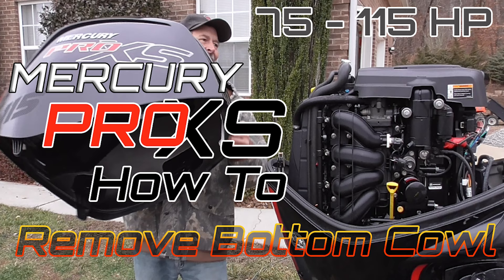At this point, you're probably thinking we'll just take it now that it's loose — lift it up out of the cowling, disconnect the hose clamp, and off we go. Unfortunately, that is just not true. If your motor is like mine, I was not able to lift this up far enough to get to that clamp even after all we've done. I actually found it necessary to loosen the bottom cowling enough to split it apart in the back and pull the fuel rail out the back side. I've created an extremely thorough video showing every step of how to do that — I'd recommend you go watch that video and then come back and pick up where you left off.